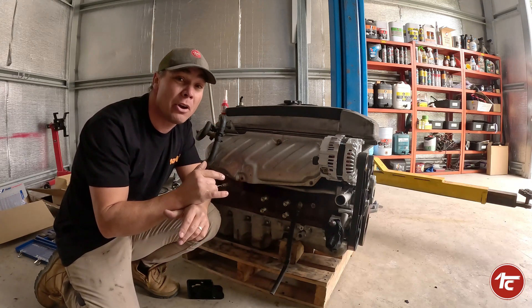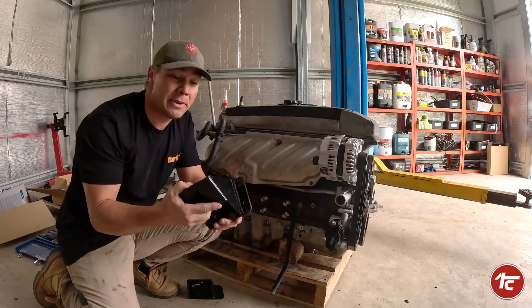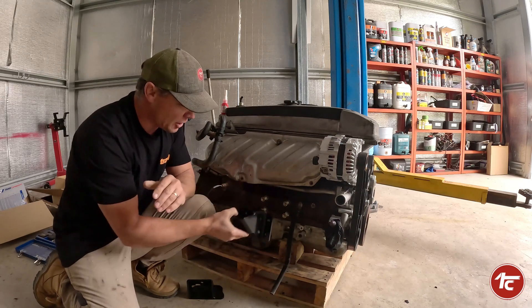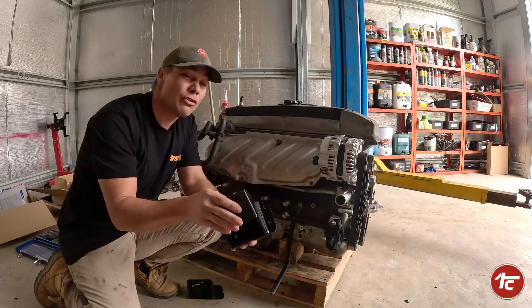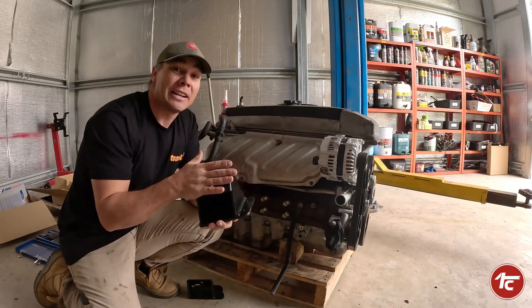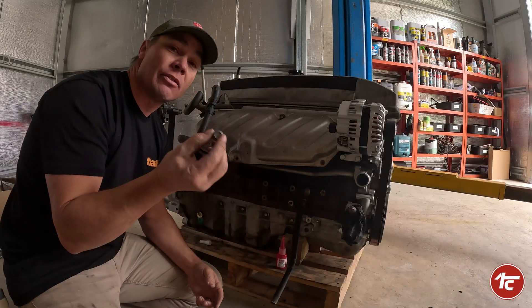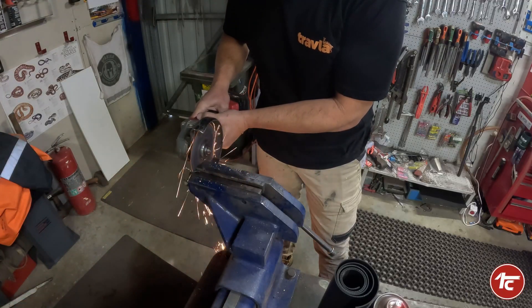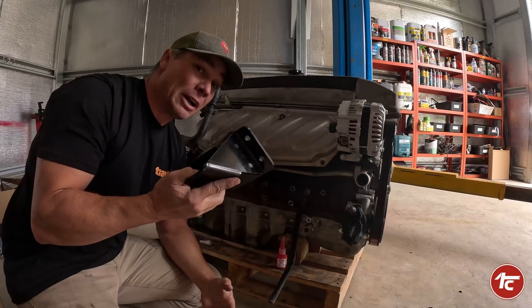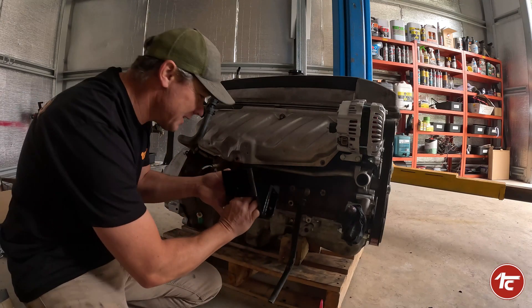We're nearly ready to call it a day for engine prepping. One last thing we need to do is engine mounts. These are the McKinnon's Cruisers engine mounts — fully designed ready to go for a Barra-to-40-series conversion. They run an 80 series engine mount, which is nice, strong, and solid — easy to get anywhere. You'll need to cut 10mm off the original bolts because you'll bottom out, as the McKinnon's ones are a bit thinner than the original genuine big alloy ones. Make sure you put thread locker on all your bolts — the hardest one is up in the top corner.